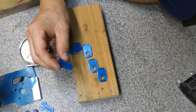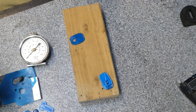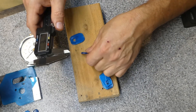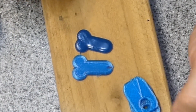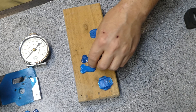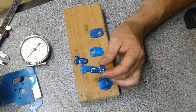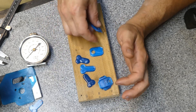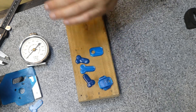Around 150°C soaked for several hours got this result — it essentially makes the plastic smooth. It also makes it smaller, though it doesn't really affect the height as much as the width. In fact with one piece it actually grew a little bit in height — about 3.22mm versus my control piece at 2.82mm, so maybe half a millimeter. You can see it got smaller in width, and essentially what we're getting is about two to five percent shrinkage. The height is more variable. For gasket applications the width shrinkage is the bigger concern, including the hole, but the nice thing about printing plastic is you can correct that by scaling up the file when you print.